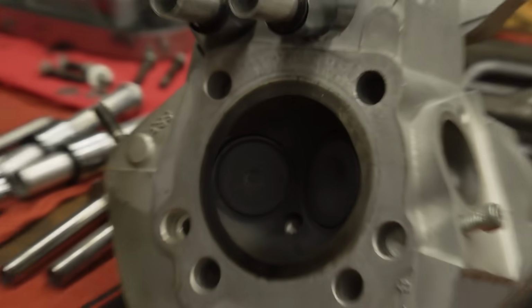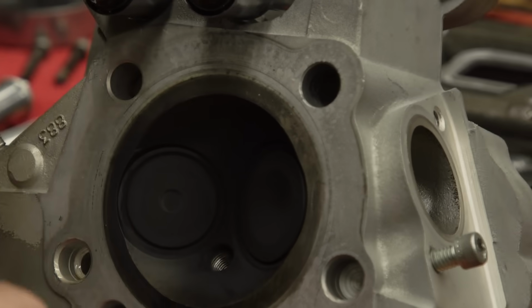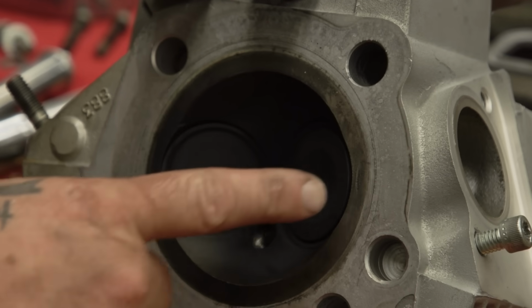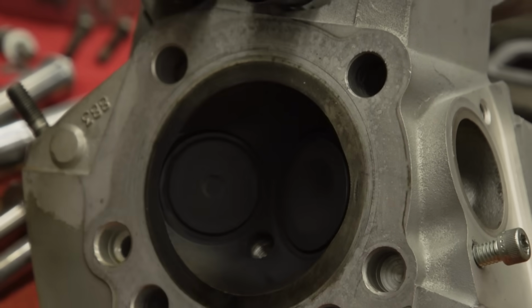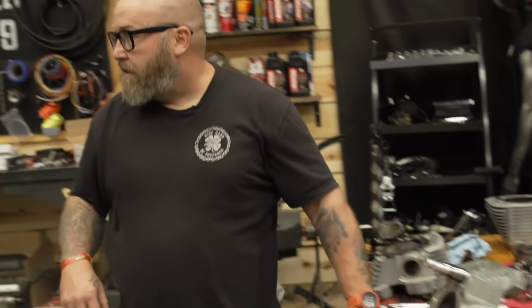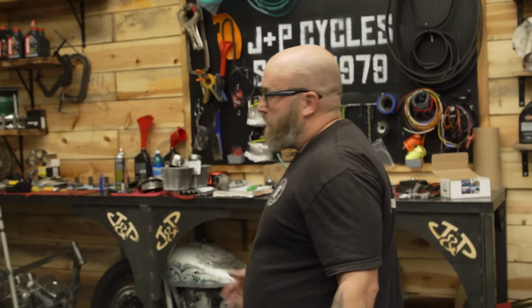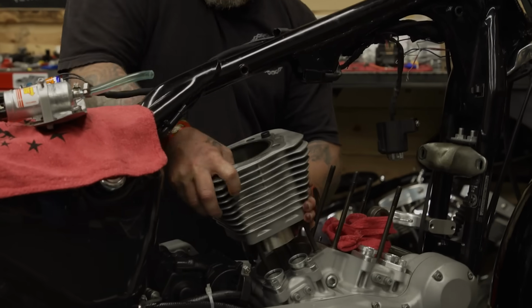That's the mark where that piston kissed that. Now, a couple things just off the top of my head. The fact that just that part hit that makes me think a ring broke off in there, because it's really odd that it's just that one tiny mark. But let's pull a cylinder off there and then we'll see where we're at.